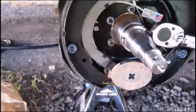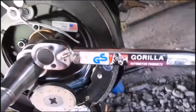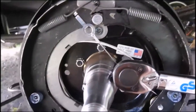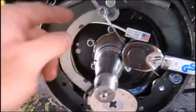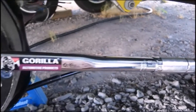The new assembly is put in place. I still need to attach the wires. What I'm doing now is torquing the nuts for the bolts here to 50 foot-pounds using a clicker-type torque wrench.